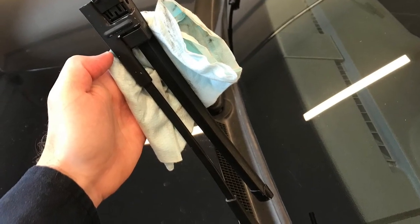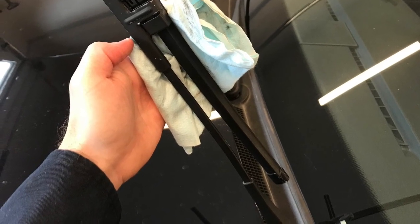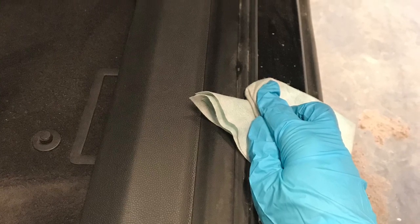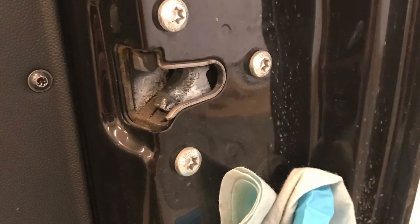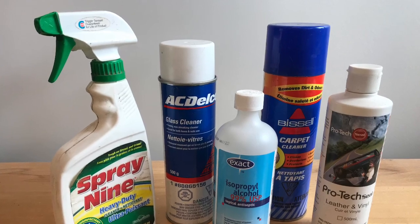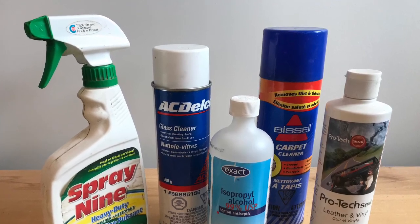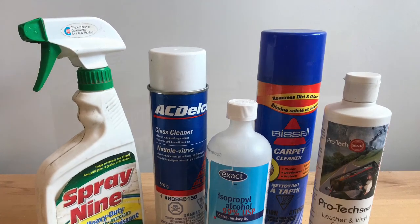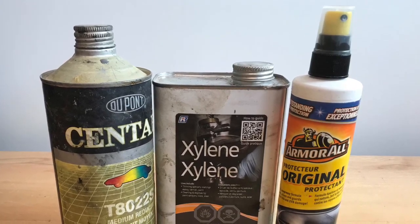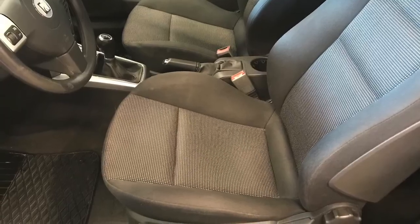Remember to wipe the wiper blades, as they get very dirty underneath — when you have a clean windshield and turn the wipers on, they can dirty the windshield immediately. Towards the end of the cleaning process, make sure to wipe out all the door jambs and the door side as well, and repeat this process for any other openings such as hatches, liftgate, tailgate, and underhood areas. There are many appropriate cleaning products that can be used, but one of the best items is water with a mild detergent — it's very unlikely to damage anything or leave any residue. Avoid solvents or anything that could be a contaminant for the body shop, anything containing silicone, or any other type of contaminants. Thank you for watching and I hope this will help with your detailing process in the future.